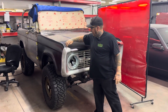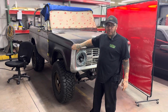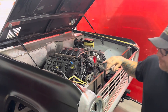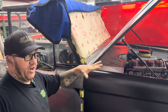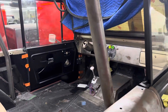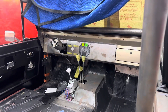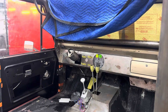The Bronco has had a lot of stuff going on too — lots of little stuff like just getting the gaps right, fender to hood. The grille is completely misshaped so we had to reshape all of that to fit properly. Under the hood we're in the middle of trying to do some work around the battery tray, designing some covers and panels. The hood itself didn't fit good so we've had to gap that so it doesn't touch when you open it. On the dashboard we're doing a push button start, we have our low-profile sports shifter for the 6R80 that's in it, a GM tilt column, and a set of Dakota Digital gauges moved to the center of the dashboard — kind of more aesthetically pleasing.